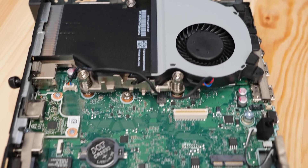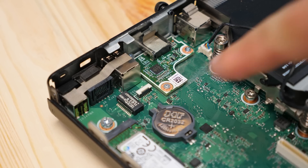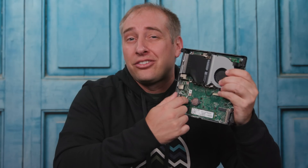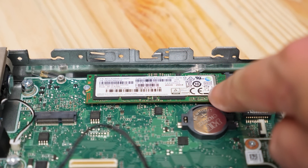The bottom part of the unit is a little different than we've seen in some other units. We do not have the hard drive carrier, and there's also this little tiny slot which is actually the SATA data connector — just a little proprietary cable. If you don't have that, it's a big deal because you have to source not just the carrier to hold the two-and-a-half-inch drive, but also that little SATA cable. We did get a really nice Samsung PM981 256GB NVMe SSD, which is a very nice drive — some units came with inexpensive DRAM-less SSDs that are much lower performance.